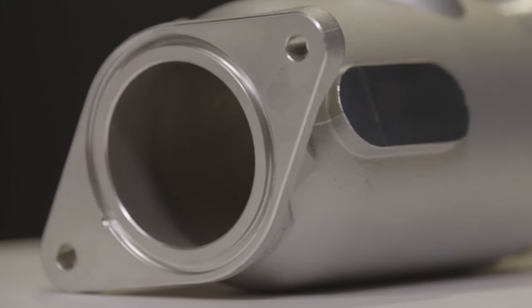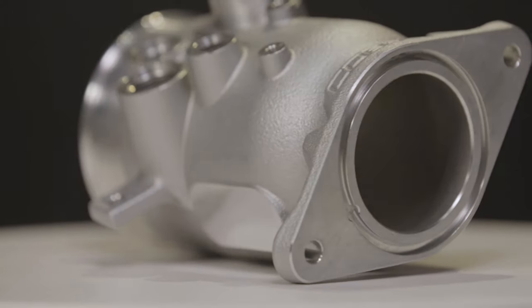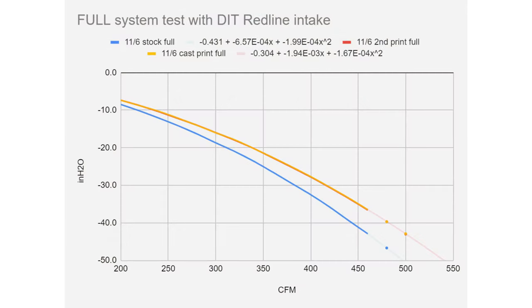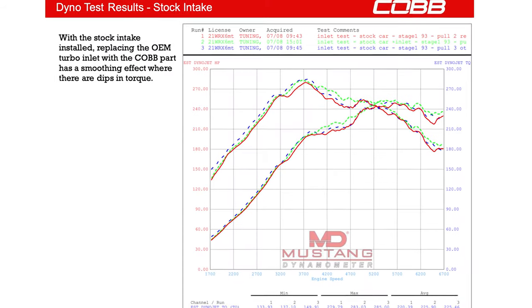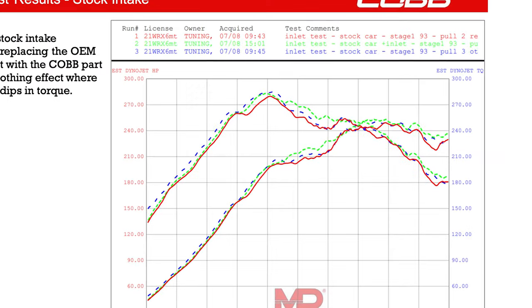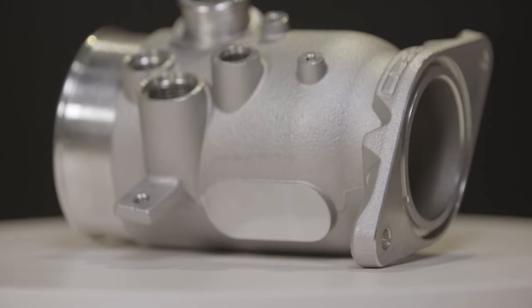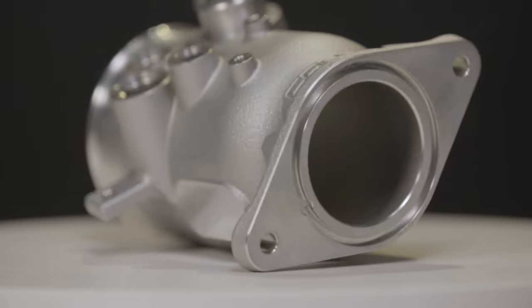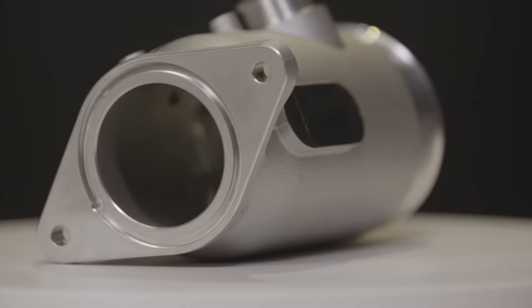Plus, the groove for the O-ring has a dovetail design that captures the O-ring to keep it in place, ensuring a proper seal and making installation easier. We've tested to find a measurable increase in airflow on our flow bench, as well as dyno testing that shows improvements in the annoying torque dips that can occur on a stock intake system in the mid to high RPM ranges. Plus, we left enough meat on the bone of the outlet to allow for porting from 50 to 55mm to fit a slightly larger turbo.